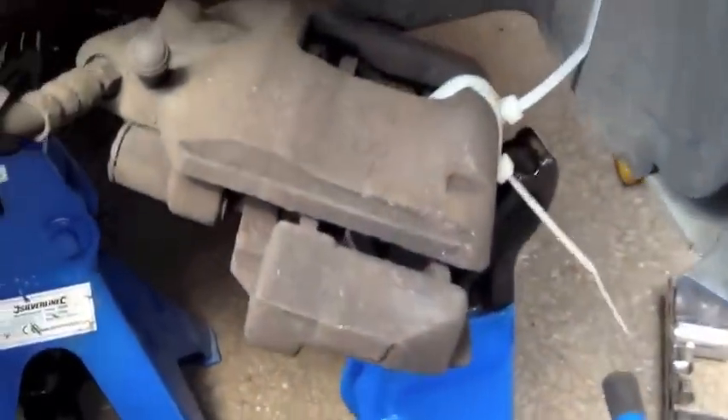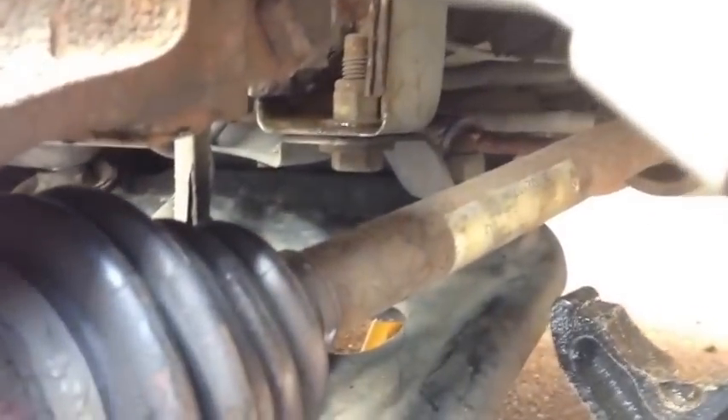So we've taken the brake caliper off and just suspended it there, zip tied it to the axle stand — those two 13mm bolts. I forgot to mention, on the bottom of the track rod end bolt there's a cotter pin in there. I think Americans call it a cotter pin; I can't remember what we call it. So I just need to take that out. Then this bottom pinch bolt, which I think is a 15mm, and the top pinch bolt there at 19mm, I believe.